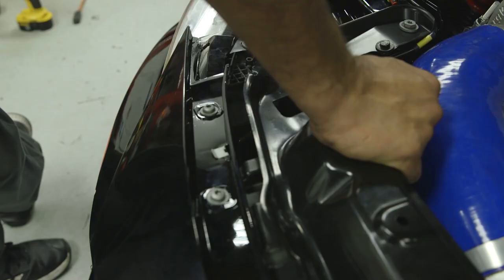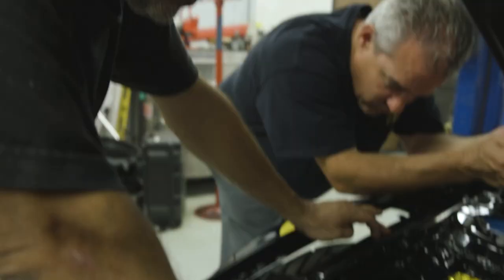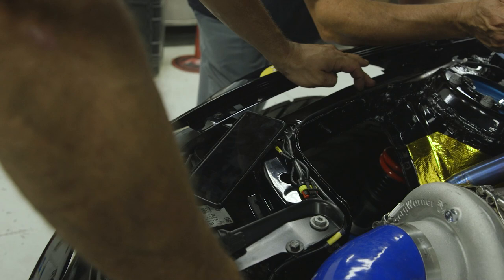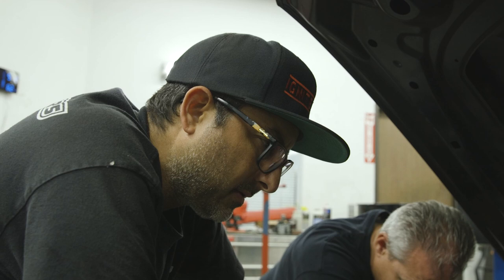If it's a vacuum for the brake booster, basically it pumps and it creates a certain amount of vacuum, and then it can't go higher than that, right? Otherwise you'd have an insane amount of vacuum assist. So there's some sort of regulator somewhere, but is it outside of the block? Is it somewhere else in the system? Now that thing is just pumping like crazy and pulling vacuum from somewhere else, but how is it getting oil into the cylinders without creating any crankcase vacuum?